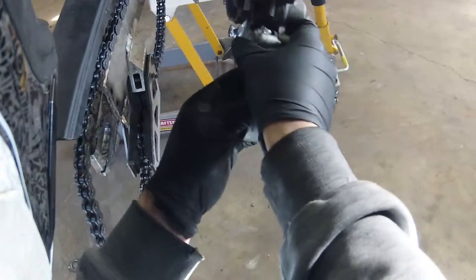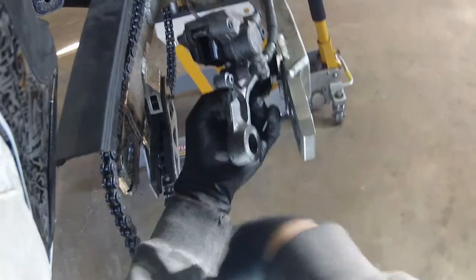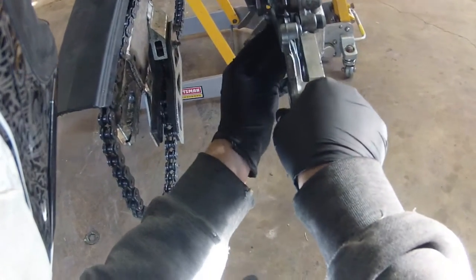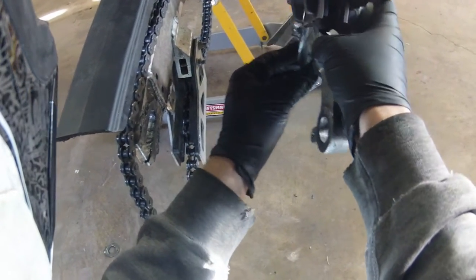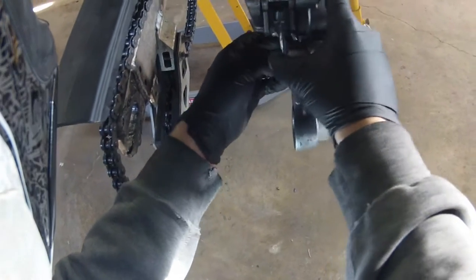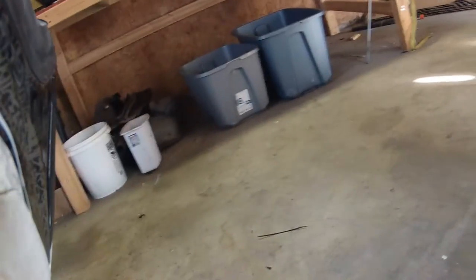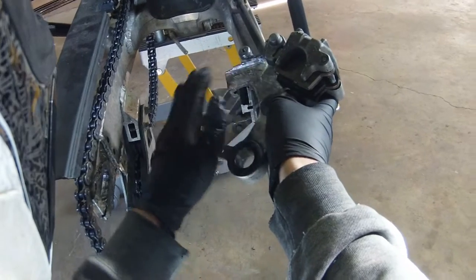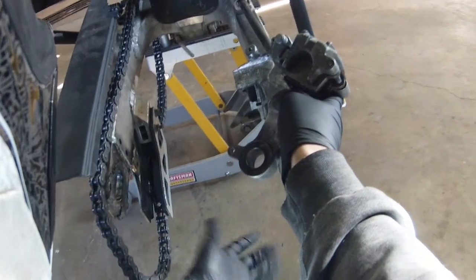The next critical thing is to swap out your stock DRZ 400S caliper carrier. This is just this piece, and the caliper is held on by a bolt and a floating pin — undo that bolt and it should pull off your stock carrier. Put the new one on; it's a floating carrier so just get it all lined up. I was having some rotor drag, especially at a certain point on the rotor, so I took a Dremel and dremeled all of that area out, and now it has no rotor drag at all.